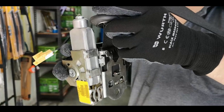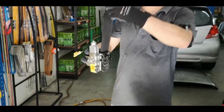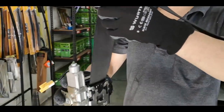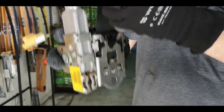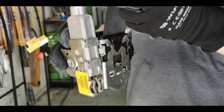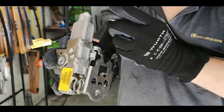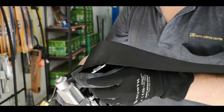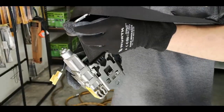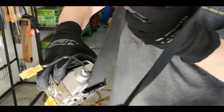So this is the seat belt locking mechanism that we have taken out — it's fully functional now. In the vertical position it's okay. As long as there is a sudden jerk, it will lock a bit. And if it moves left or right, or moves forward and backwards, the mechanism will also lock.